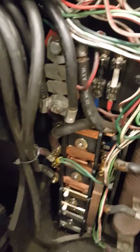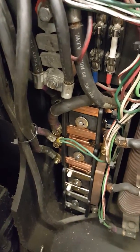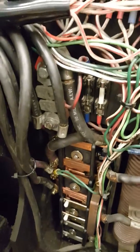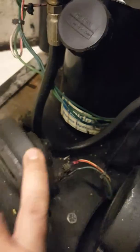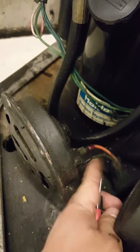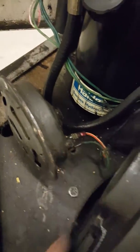After installing those two fuses, we've got to check and make sure they're good before we start it up. And first we need to find out why the fuses were blowing. The cables are up in here, and we've got loose wires over here by the positive signal on the horn — they're touching ground and blowing the fuses.